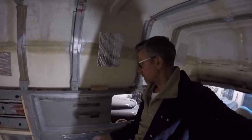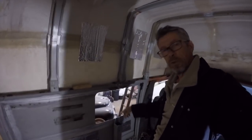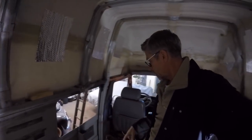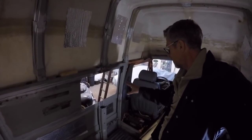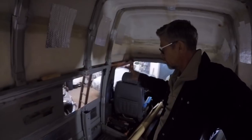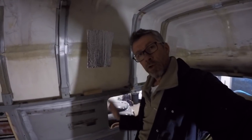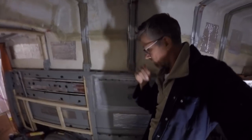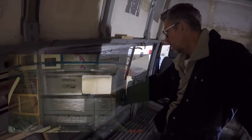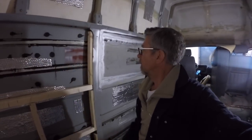The biggest recent change is welding in this new steel panel and cutting out the space for the new caravan window. It's going to be a bench seat just here and it'll be a front dinette. The front seat spins around, so that's why I've moved the window. From here back it's going to be fridge, grill, and then a shower behind that, and then the bed which goes across the back. I need to put a welded steel beam back in here for structural strength — I've got to order that for next time, and it's going to be a fairly expensive bit of structure.